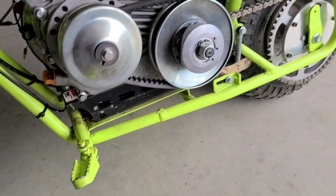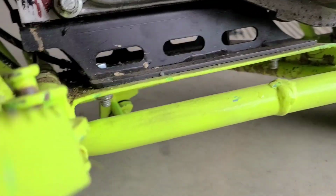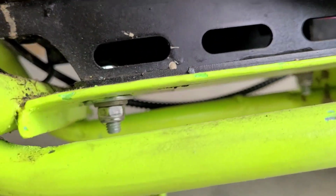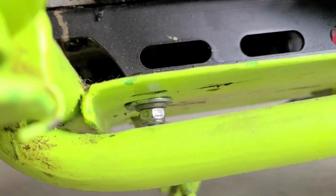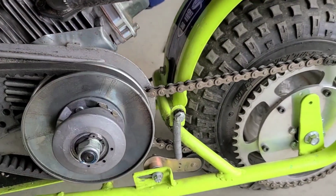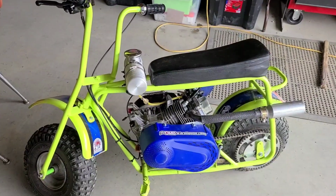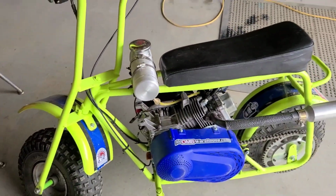Okay, so before we put the torque converter cover on, I'm going to get a little bit of the slack out of this chain. The way we're going to do that is just loosening the nuts and the bolts that hold this on to the plate on the doodle bug itself. You can see I have some slots in this. These are slotted where this is mounted, so we're just going to bring it forward a little. That's what we call perfect chain tension, if you want to look that one up in your cookbook. Torque converter cover is on. Like that, we're done and we're ready for fun.